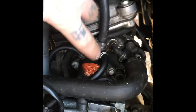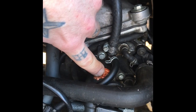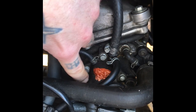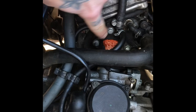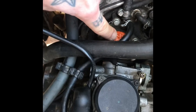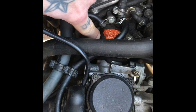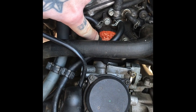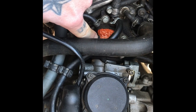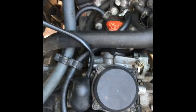I did smear a little putty right there - he had a crack that was starting in this neck. For now we just covered it up, but we're going to order one and replace it. It's not going to stay like that, because if that crack continues and starts sucking air in, you'll have a very high idle and the engine will run very lean because it's getting a lot more air than what these jets are designed to compensate for.